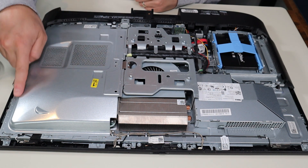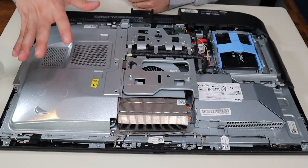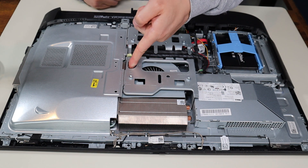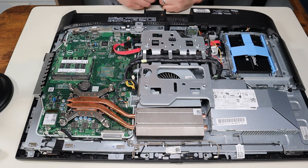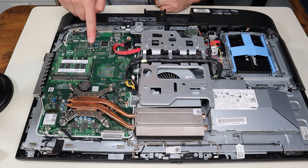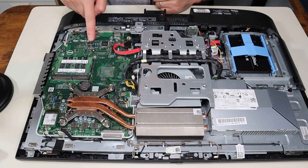Right here you have this metal panel to access some more components. Again, no screws — this is a very nice computer to work on. There's just a pull tab here; you push that down a little bit and then slide it that way, and that panel comes right off pretty easily. If you really would like to upgrade your storage as well, there's a single M.2 port right here that holds the smaller 2230 and 2280 solid-state drives. I will have several replacement and upgrade options for this solid-state drive port below in the description as well.